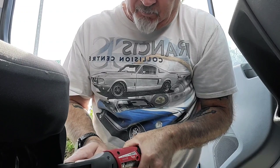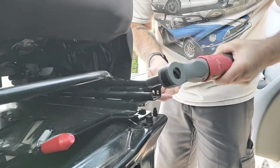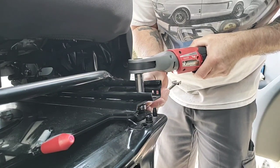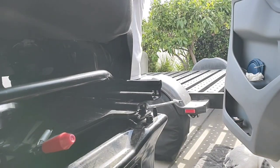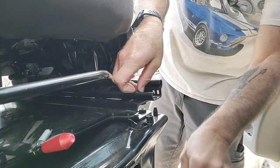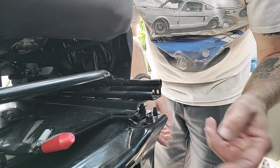We have the amazing auto seat — I think it's from Sprinter Swivel. Take a 13 millimeter socket and a wrench to remove the seat off of these. It's always a good idea to get a magnetic bowl and throw your nuts and bolts in there so you don't lose them — you can do that with your bits too. That will come out once I get the other three out; when I lift it up I can pull the bolts out.